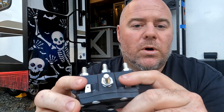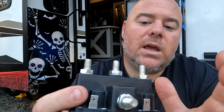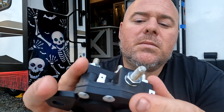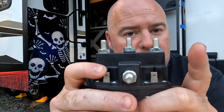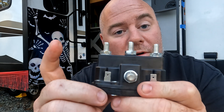Now that we have our reversing solenoid out of the trailer, I'll talk about how exactly these things work. They have six ports on them — four cable ports and two wire ports for your signal. These two smaller ports are for your signal wires. You have a battery negative port, a battery positive port, and then two studs for your electric motor — a reversing motor that can spin both directions. That's why they call it a reversing solenoid. You're going to get a 12-volt signal on either one of these signal studs, coming from either a switch or the electronic leveling controller in your Lippert leveling system.